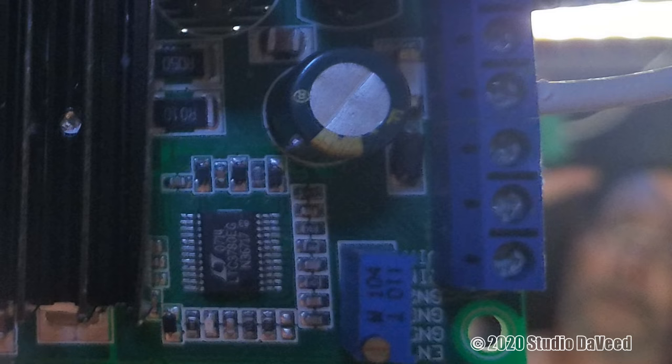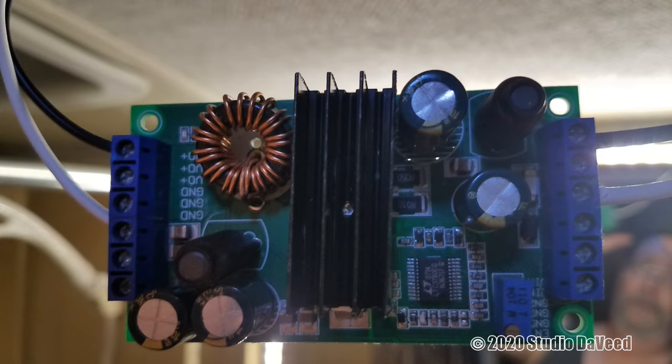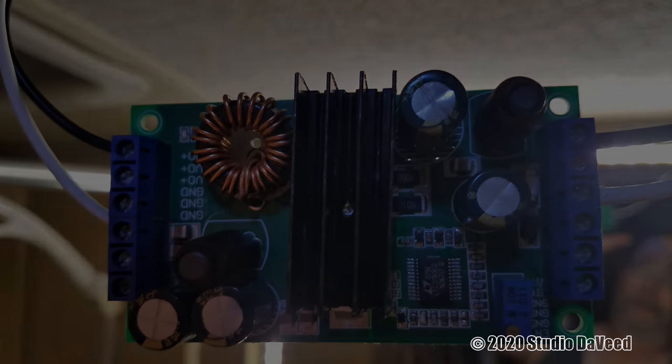Here is the quick step-by-step procedure I followed based on a forum I found — the link to that forum is also in the video description. My fans were switched with a rocker switch where most people's fans are probably direct-wired, so I had the ability to cut power to the fan. But if you do not have a switched fan, you'll want to kill the power or pull the fuse that runs the fan. Very important: always kill the power before you start.